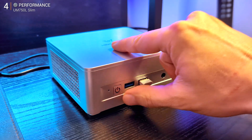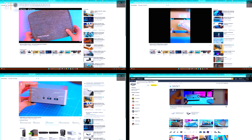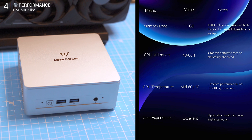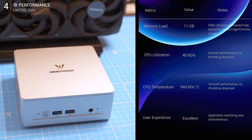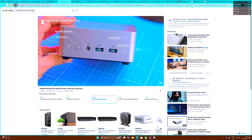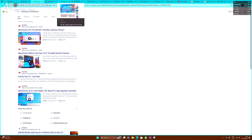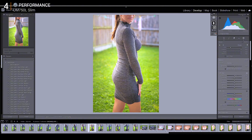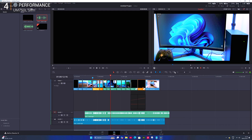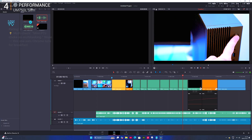Now real life. Boot time: 7 seconds to desktop. I opened 23 Chrome tabs, each streaming YouTube or Twitch — some in 4K, some in 1080p — none stuttered, switching between them instant. Memory load hit around 11 gigs, CPU 40 to 60 percent, and temps in the mid-60s Celsius. So yes, it passes the chaotic multitasking test easily. Office and productivity: Word, Excel, Outlook — all at once, zero lag. Photo editing in Photoshop and light 1080p video cuts in DaVinci Resolve were fully usable. Rendering a 2-minute 1080p H.264 clip took about 58 seconds — not workstation class, but solid in its class.